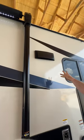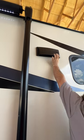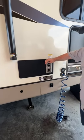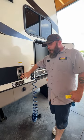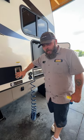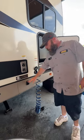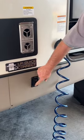The top is going to be our vent for the stove. Right now this guy is closed — you would want to pop this open whenever you go to cook. Then this guy here is going to be our furnace intake and outtake. I do recommend trying not to block this, but would recommend getting mud dauber screens to put over this so it keeps the mud daubers and wasps from building in there, because that will cause issues with it properly working.